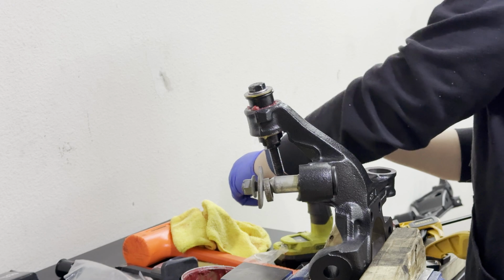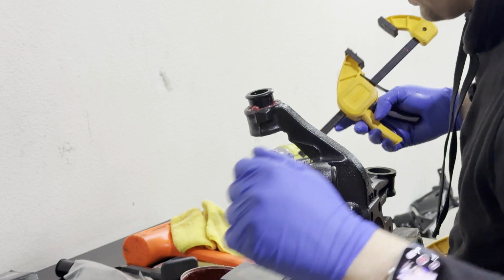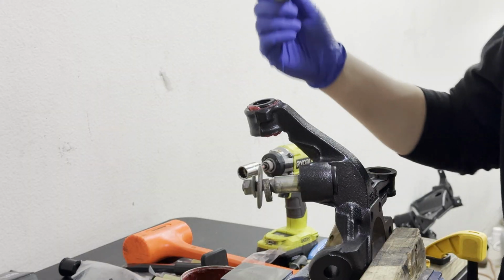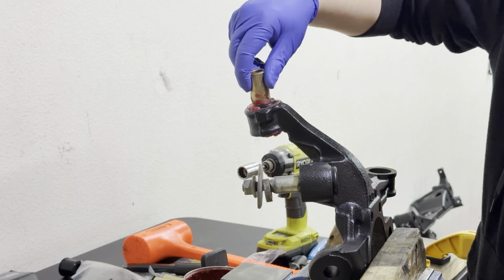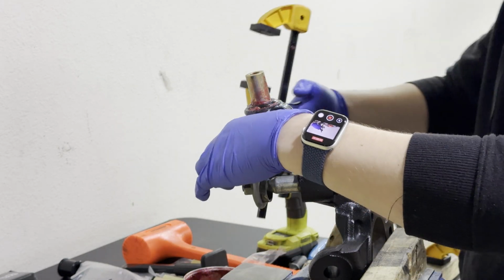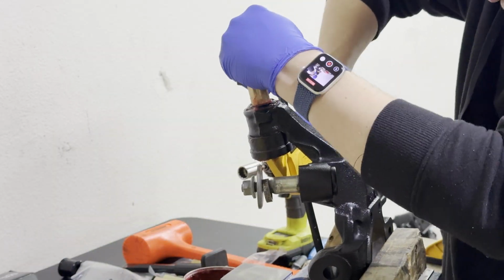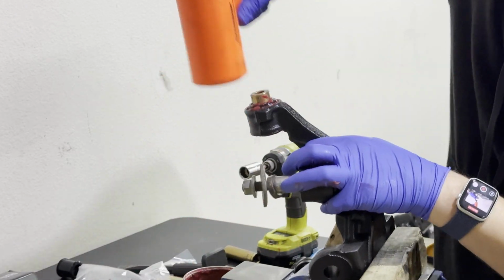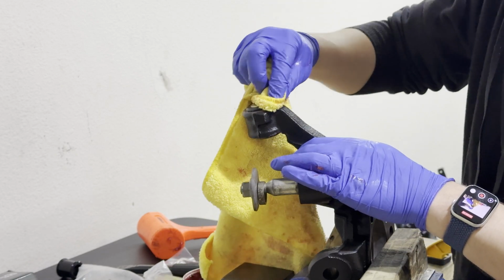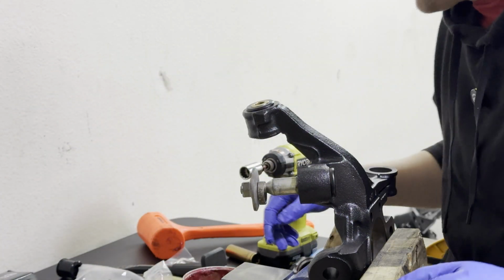What we'll do is we'll remove the bolt, and we'll use a C-clamp here. There we go. And then for the metal sleeve, same thing: lubricate it, get it seated, and then we'll do a similar approach using the coupler, and then we'll go ahead and press it in, make sure it complies. A little extra convincing. I will re-grease this later. That's pretty key with these bushings. You do have to apply a lot of grease and you do have to service them occasionally, but because this car is going to be mainly garage, I don't think it's going to be too much of an issue.